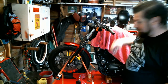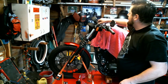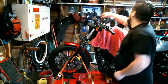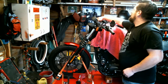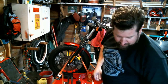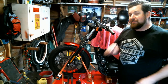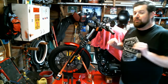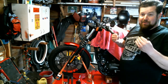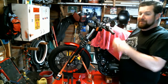Setting our caps in a safe, clean, and dry spot. Now we've got preload spacers — going to pull those out and discard them. As we pull the fork springs out, we're going to take a screwdriver and stick it through them to hold them up, because there's oil on the fork springs. It's very important with your forks to have equal amounts of oil in both fork tubes. We're going to lift them up a little bit, letting oil that's on them drain back down, and go to the other side letting oil drain back down.